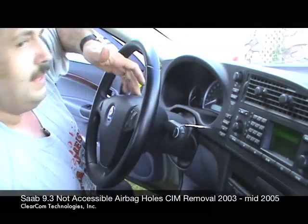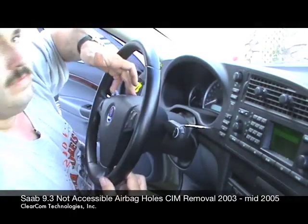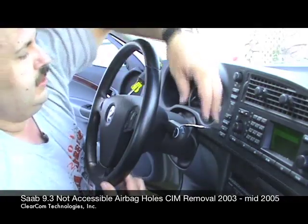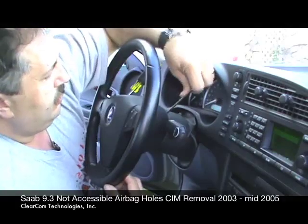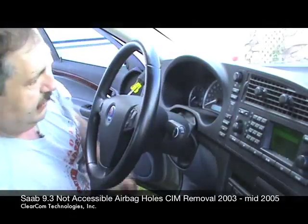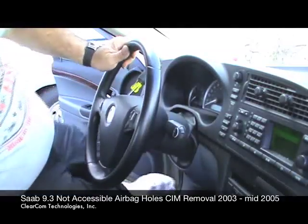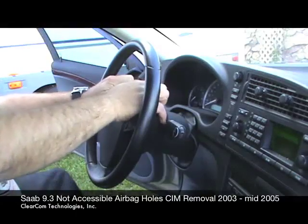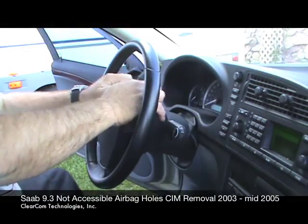You can see the airbag pops out about 1/4 of an inch all the way across the top. It popped out 1/4 of an inch here. It's now popped out 1/4 of an inch here. I'm going to rotate the tool and take it back out since we're now released, and get in the car so I can pull this away. You don't want to pull the airbag too hard or too fast because the pigtail's only about 3 inches.